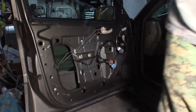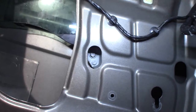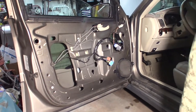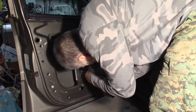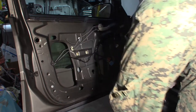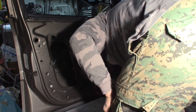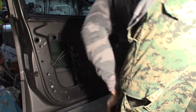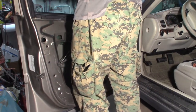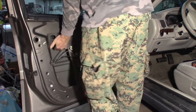Let me bring you over here — I'll show you. You can look in there, you see that bolt on both sides. You've got to line them up and then take those two bolts out. There's the window — be careful you don't drop the window. One... these are short, definitely shorter than the other ones I took out. Two — I think that's it. Now I might want to take this window and disconnect it from the arm, place it out of my way.